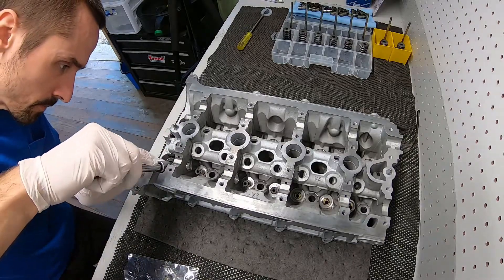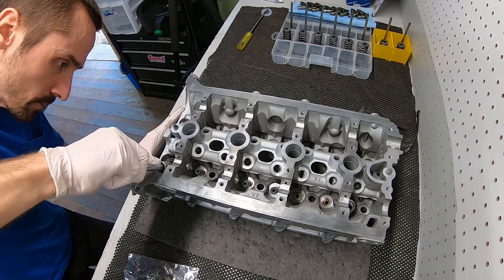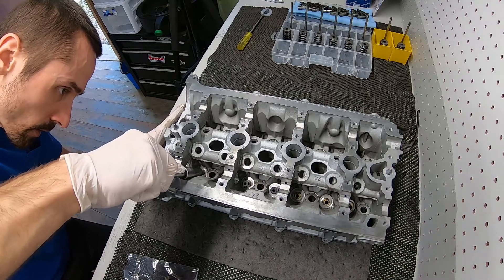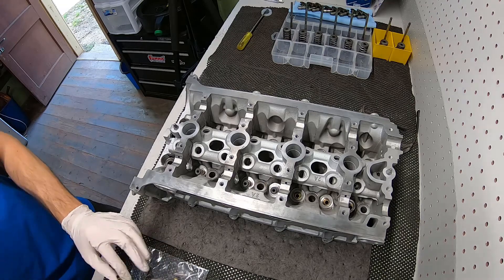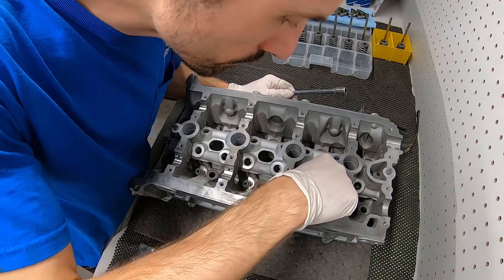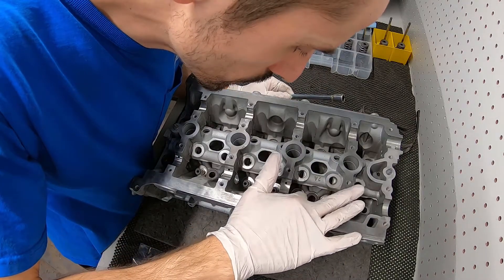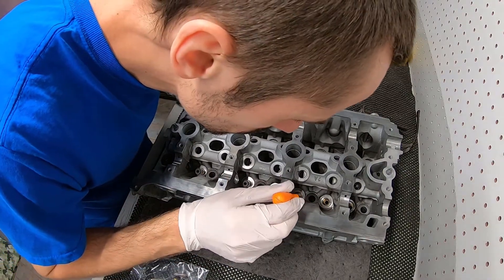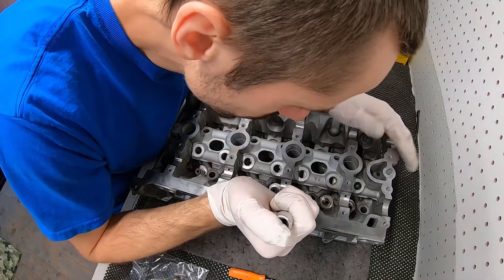It's a very common job and a very common failure point. A lot of times when you see a car that isn't smoking while it's driving, but then stops at a stoplight and smokes a little on the takeoff — that can either be rings or, more usually, valve stem seals. You can spot that a mile away. Literally.